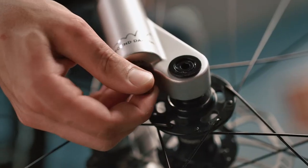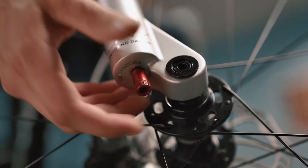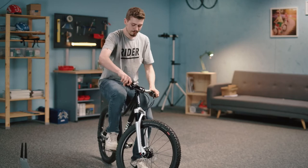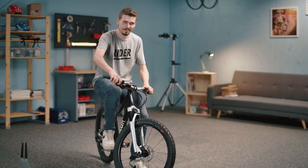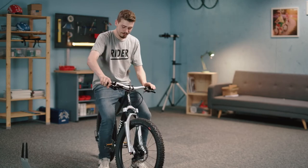You'll want the shock's rebound speed to be fast when riding over bumpier terrain, whereas a slower shock speed is better for flatter, smoother ground. It ultimately comes down to personal preference. Try it out and see what setting works best for your kid.